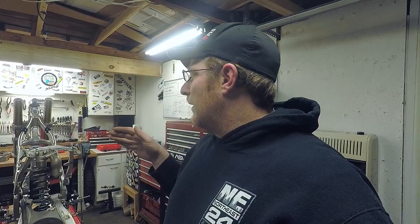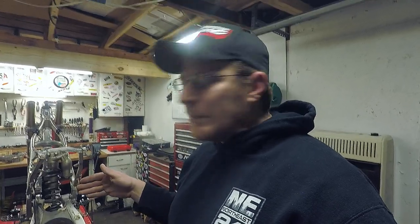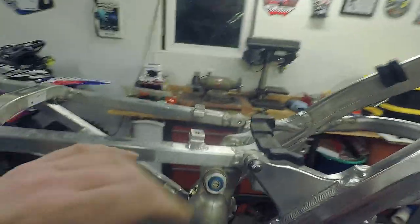I actually made a living for about five years as a welder fabricator — straightening frames on semis, dump trailers, re-welding them and things like that. I hate working with aluminum, which is why I outsourced welding the frame on this project. This I know I can probably bend back; it might crack, and if it does I'll just send it over to Jeremy and he can weld it up. But I need to get it into a spot where I know it's going to be straight and square. The basic theory is: it's a box, you just want to make basic measurements.